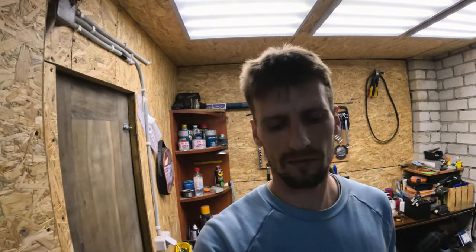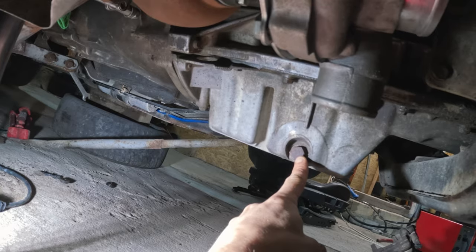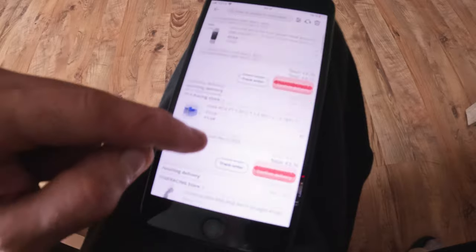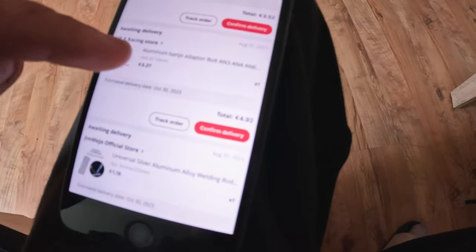For the feed I'll have to buy a 45-degree elbow which fits our hose end and then install the line — pretty straightforward. It's still not very clear with the oil drain, so today I'll be going underneath the car and checking what bits I need. For the oil drain I'll try to order a fitting which converts this bolt to AN, then order a 120-degree AN8 fitting for the turbo side. I managed to find the missing parts for oil drain and feed: two AN8 fittings, one AN6 fitting into the oil pan for feed, and a banjo adapter.